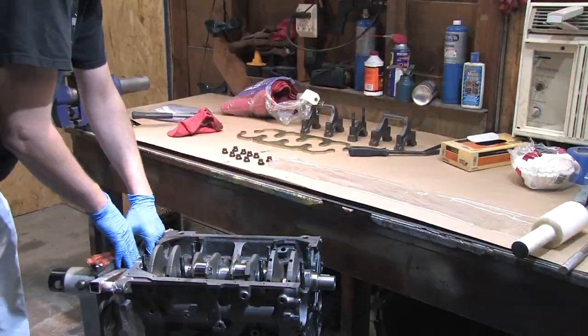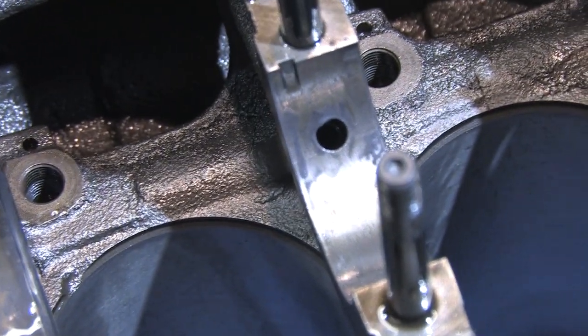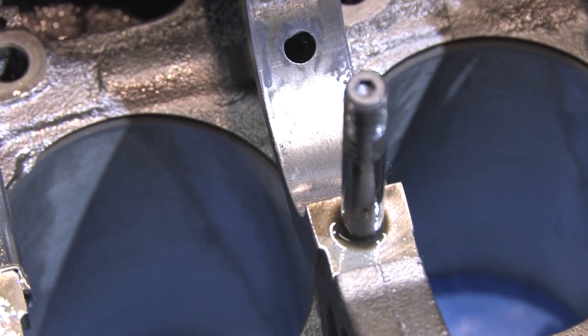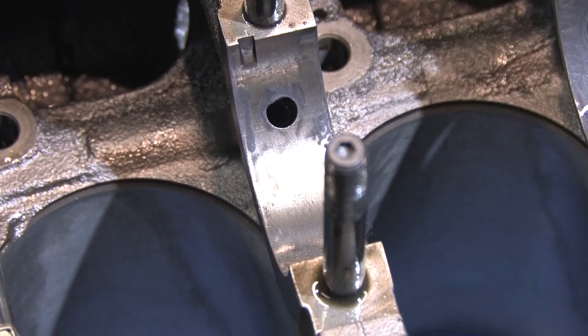The kinds of challenges you encounter with a cast iron block are different, but the tooling isn't much different, and neither is the surface preparation. The block is more opened up and accessible, which is nice because it allows you to use bigger tools, but the flash you encounter on the block behaves completely different than it does on aluminum.